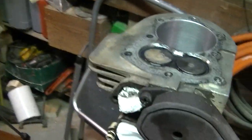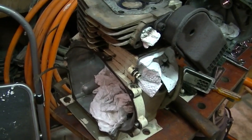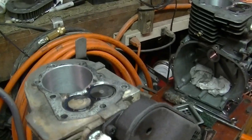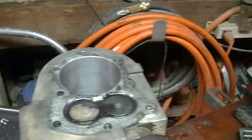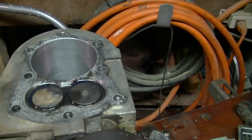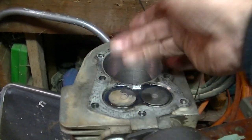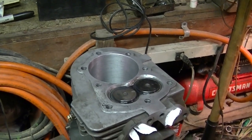But the Aaron's is the original. I don't know. I guess one other consideration is the bore size seems exactly the same, at least with the rough calipers. Hang on. With these guys here. But if I get out the digital caliper, maybe I'll see which one fits the piston better. Oh, like I said, they're so damn close, you're not going to be able to tell.